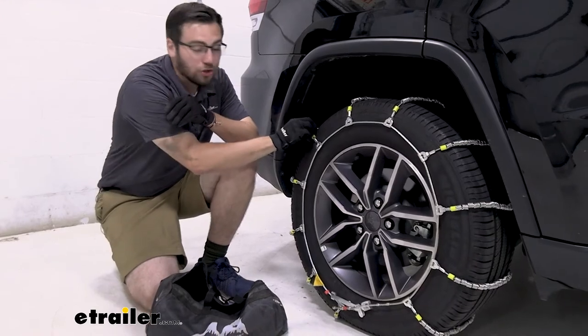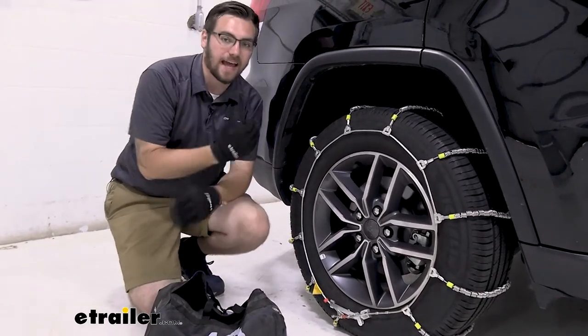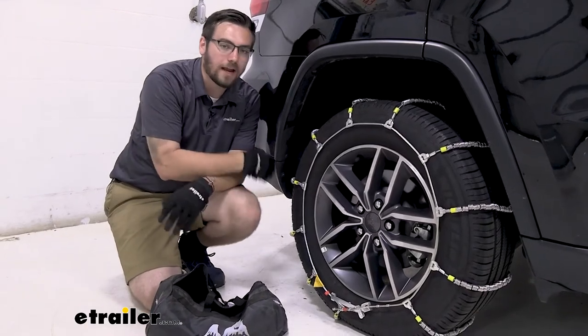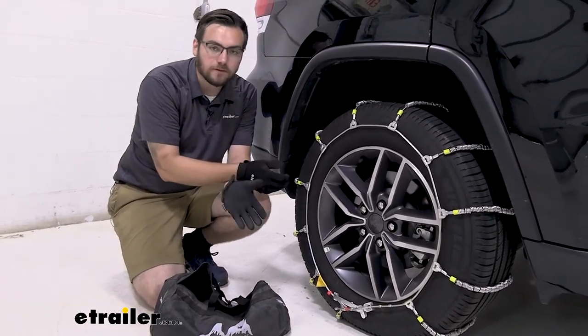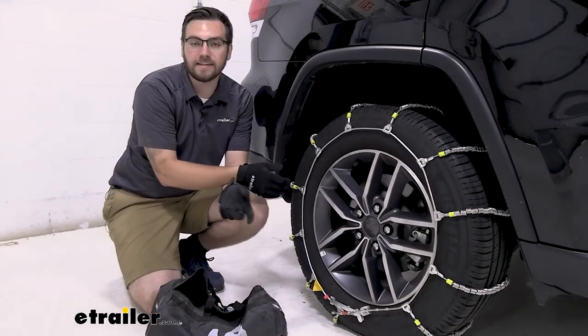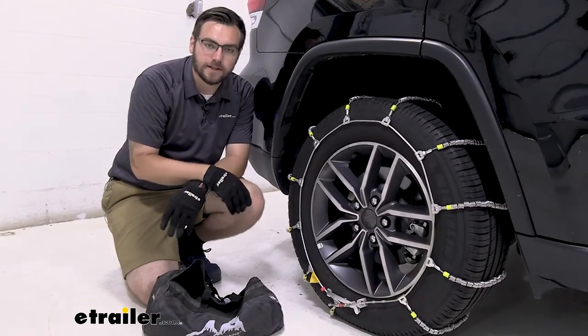One little thing too — it is made of a low carbon steel, so you are going to find yourself actually kind of degrading these chains as they go. It can be helpful to kind of rinse them off, get that salt off, and allow them to dry properly. A lot of people also like to put them in a little bit of oil or a little bit of grease. You can really start extending that lifetime of your chains for those off-seasons that you're not going to be using them.